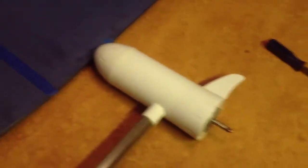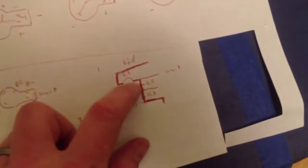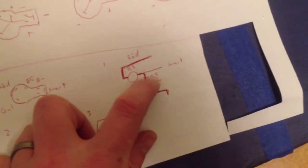Yeah, this electric motor is from a company here in Sweden called Biltema, but it's basically a water snake. It came with a switch that controls 5 speeds forwards and 2 speeds backwards, and I measured it. It's just a switch, so I figured it has to have resistor coils inside. I searched on the internet and some motors have them, so I measured a little bit. One of the coils is 0.5 ohms and one is 0.7 ohms.